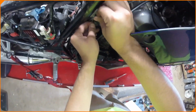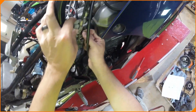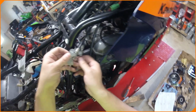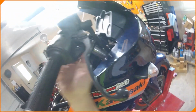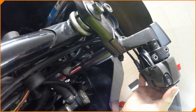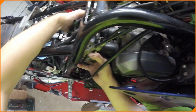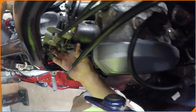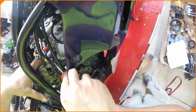And then take the whole throttle assembly off, both cables, without loosening the idle or the tensioners. So these are sticking a little bit. You almost hear something grabbing up in there. This whole assembly looks loose, and it is. Okay, we'll play with that up in there. We'll lube everything up pretty nicely, and we'll get going. Let's loosen this way up. Just barely got it loose.